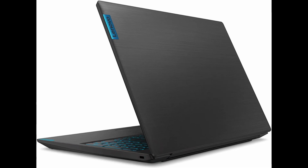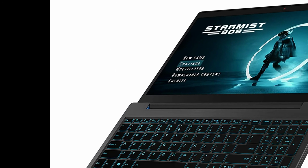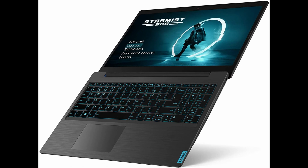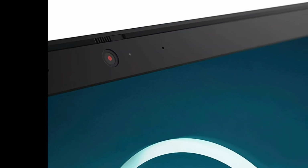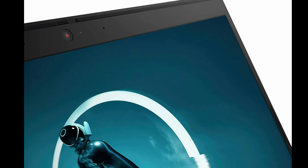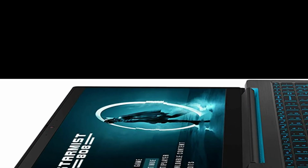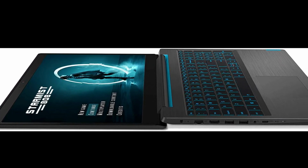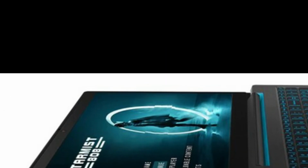Graphics card. Lenovo installs 2 versions of NVIDIA's GeForce GTX 1650 in the IdeaPad L340 gaming, so buyers can choose between 3 and 4 GB of video memory. The latter is used in our review model and shows results in the lower midfield in the 3D-Mark benchmarks. Compared to our tests with other laptops with this GPU, however, the Lenovo laptop performs slightly above average. On battery power, users have to expect a decrease in performance of about 14%.